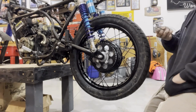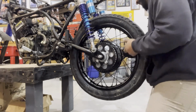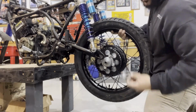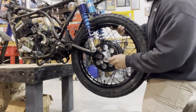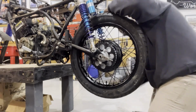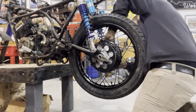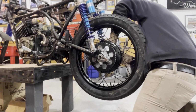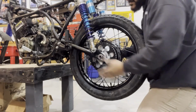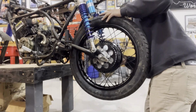Oh, yep, that's what I forgot. Our axle adjusters. Thought there was something, couldn't think of it. So there are two different sizes. One has a bigger hole than the other. So bigger hole goes on drive side, smaller hole goes on brake side. I thought something wasn't lining up quite right. There we go. Now everything seems snug. Like a glove, like a glove.